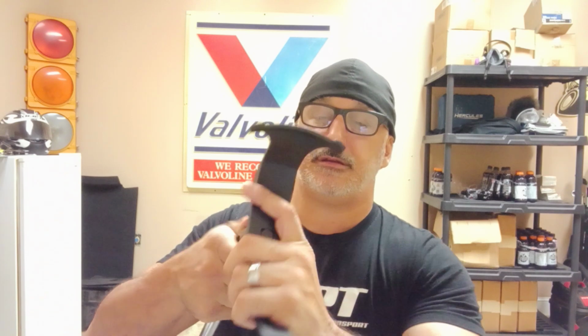To give you an idea of how much torque I was putting on this thing, it was about the same amount as if you were snugging up some lug nuts on a rim, like getting your initial torque in right before you hit it with a torque wrench to say 120 foot-pounds. It felt like I was snugging up lug nuts. That's how much pressure I was putting on the tool on that lock ring to pop it off, and then to get it back on, just as much pressure.